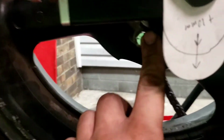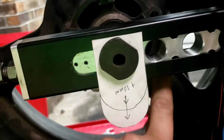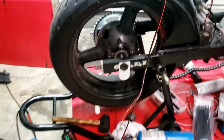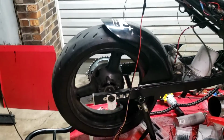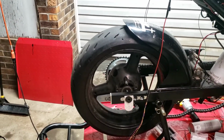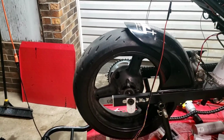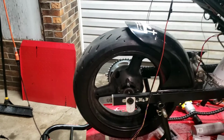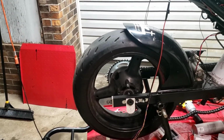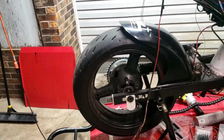So it's going to read off of this bolt, a bolt here, bolt here, bolt here, and a bolt here. We got 5. Now, a lot of people do these on 4-wheel drive transfer cases to get transfer case output shaft speed. That will be 4 bolts, so 5 should give us an accurate enough read. We only really need it to start reading at about 10 mile an hour. 10, maybe 15, depending on where I wind up coming in with the ramp. I'm planning to ramp it at 10 mile an hour.